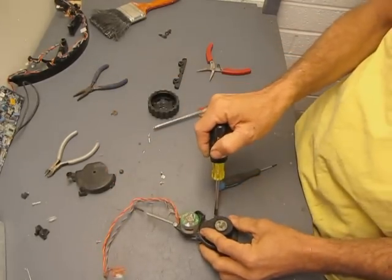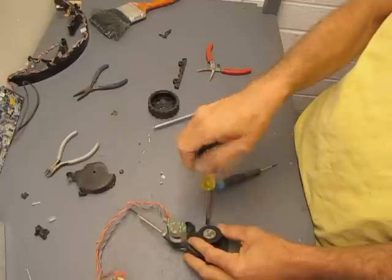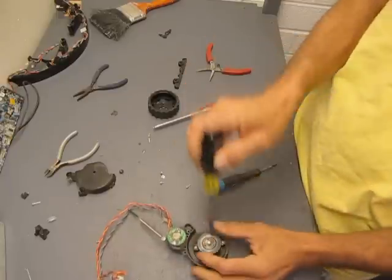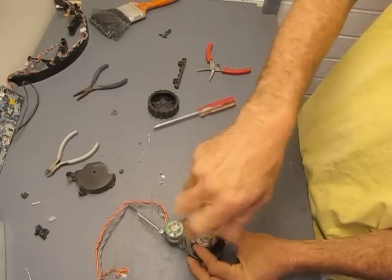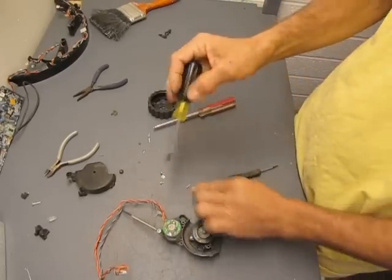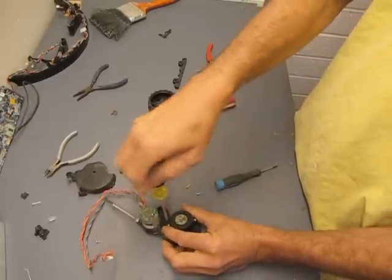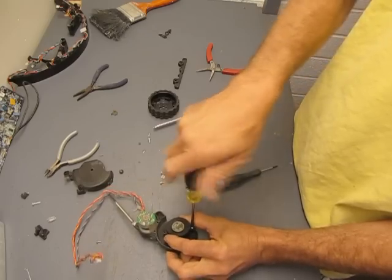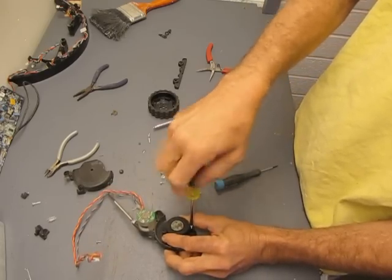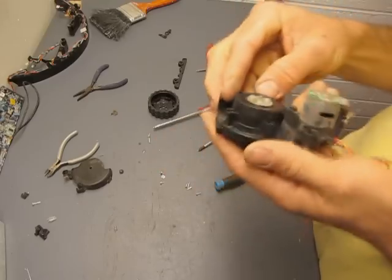You have to be kind of careful when you lift this cover off, and it's best to have the cover on the other side because everything kind of gets loose and wants to fall back through if you don't. It wouldn't be impossible to put everything back together, but anytime you're taking these things apart, just go slow, watch carefully as you lift off covers where gears go, because sometimes things tend to fly apart and it can be a little difficult to discern exactly where they go again.